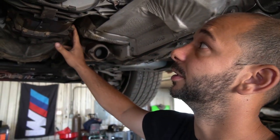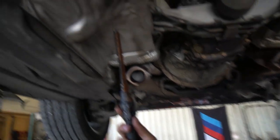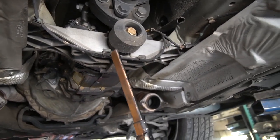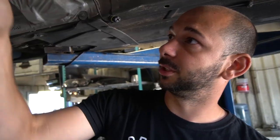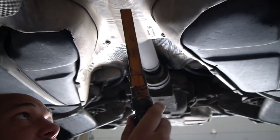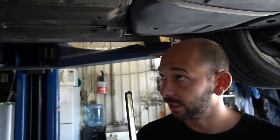Here's our transmission. First thing we're going to do is remove everything behind the transmission and then work on the front parts. Things that are in your way: heat shield, heat shield, heat shield, drive shaft. You also have the O2 sensor wiring that comes down on the transmission cross brace. There's also a little heat shield that covers the drive shaft. Heat shields are all tens and eights all the way around.